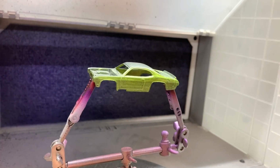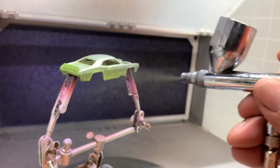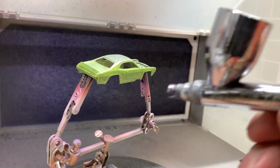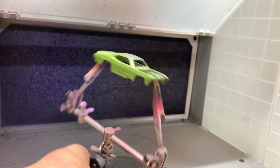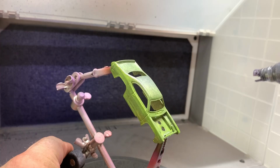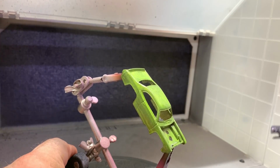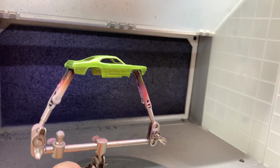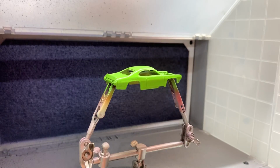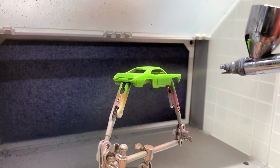Now, since we're doing a complete color change and we're using opaque paints, we don't really have to go in there and sand out any toning or use any Scotch-Brite pads. Unless you want to smooth it out or something, there's no need to do all that. Once you do your degreasing and you're going to cover it with opaque paint, just go to town with it. Some people like to put primer down. Sometimes it's just not necessary.